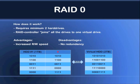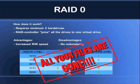Until your hard drive fails. What happens when, in this case, hard drive number two fails? Well, first of all, all the data on that drive is no longer accessible. It actually results in all of your two terabytes of data being lost. The reason for that is that disk number two had all the second halves of the data. So even though disk drive number one is still alive, it only contains half a set of each piece of data, so it's no longer usable. The end result is all your files are gone.